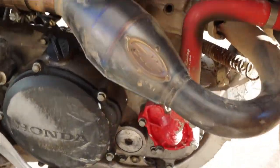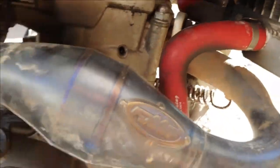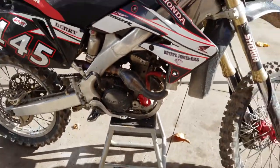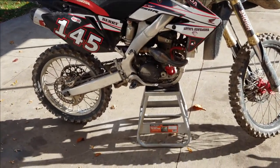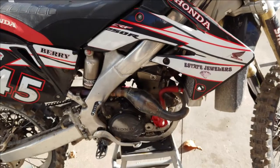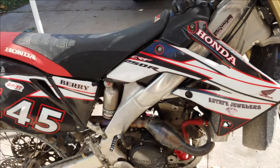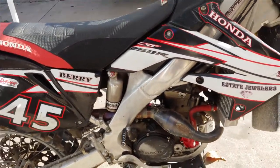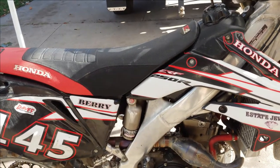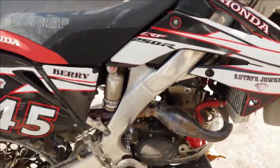You can see all the soot it was putting out right there. I'm thinking it was probably some sort of dirt in the carb, went lean on one circuit - probably like the pilot circuit - just heated that pipe up. He let it warm up, made that pipe cherry red, took off and then ripped a hole in it or blew it out.